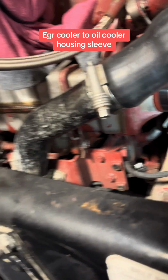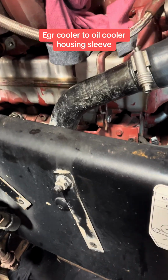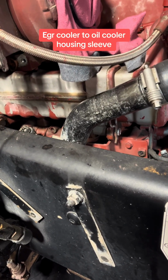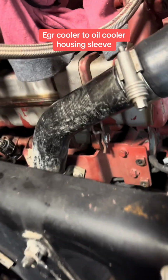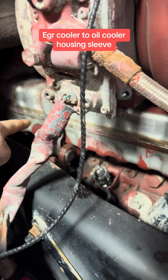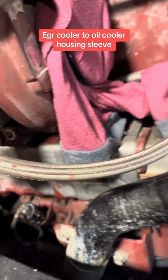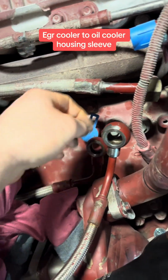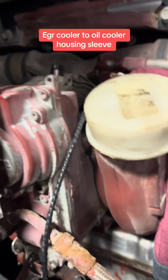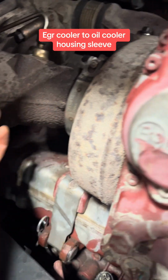But now I will not even go through that. It's actually a waste of time now that I think of it. Now that I have the knowledge of what I do now, you spend more time trying to take out these guys because the bolts are sometimes a pain, and you're working in between this turbo. All you have to do is undo the coolant supplies and returns on the VGT, on the turbo itself, undo the exhaust, take out the diffuser pipe.